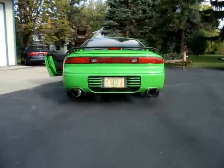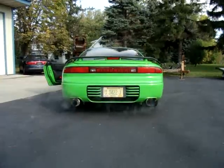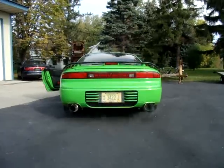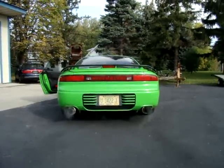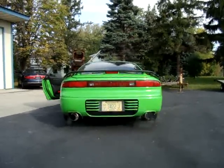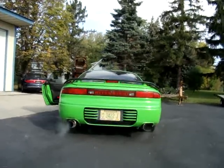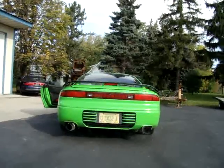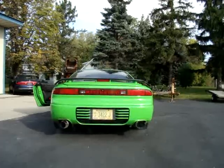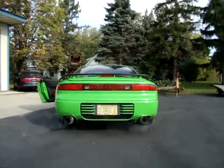So this is with DR750 turbos, I got bigger intake tubes, I got an ETS front mount intercooler, I got a Clutchmaster twin-disc clutch hardened output shaft, 680cc injectors, I got a MAF Pro with a GM mass airflow sensor, and I have the MAF Pro set up with the electronic boost control.